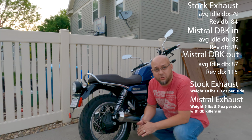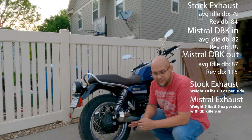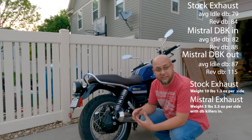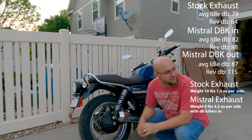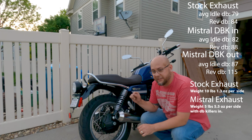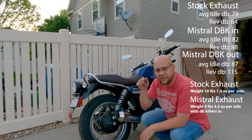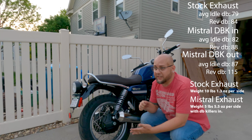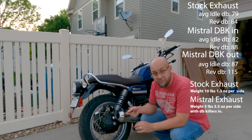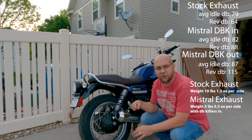Alright guys, so I know I haven't really talked a whole lot with this video. I've just been going through and doing the install and doing the overall sound test and everything like that. With the decibel killers out, while it does sound actually really loud, especially through our neighborhood right here, Mistral got in touch with David Berman. If you don't know David Berman's channel, I'll have a link to it in one of the cards on the side. They let him know that with the decibel killers out, you do need to have an ECU remap, because if not, it runs too lean, and you can actually feel it's a little sluggish on the throttle.